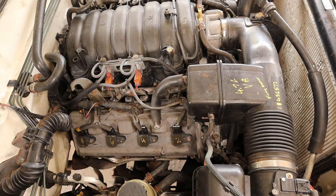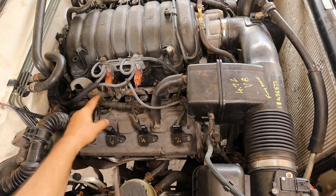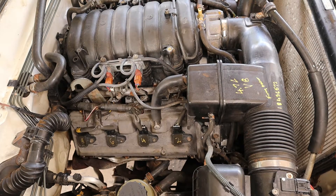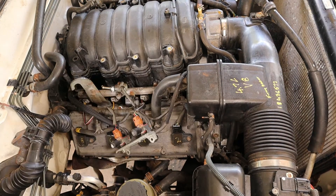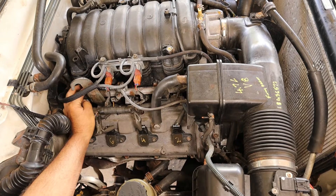On the initial visual inspection the engine looks clean — someone has been in recently. Right off the bat I notice the fuel pressure regulator clamp is loose and has slid down the hose. I've decided to replace this hose entirely; it doesn't feel like a proper fuel-rated hose — it feels really soft. I'm replacing it with rubber fuel hose rated for fuel injection systems, because using the wrong hose will cause it to turn soft and start leaking.